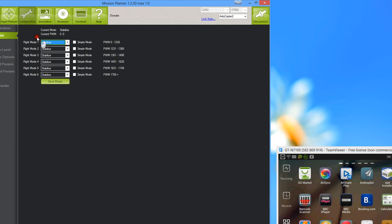On your radio, flight modes are on channel 5. If you're lucky you'll have a variable switch that lets you choose all six flight modes. Most people will have a three-position switch giving three flight mode choices. I've made a separate video on mixing channels to get more flight mode options from a cheaper radio. You set which mode corresponds to which switch position here — for example, the middle position goes to mode 4.